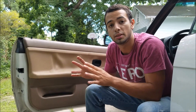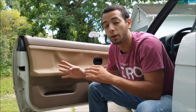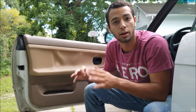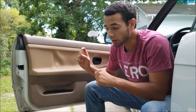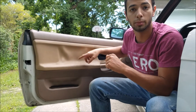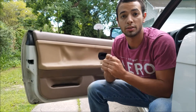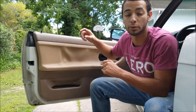The issue with his was kind of really obvious to me. The door panel is still on it, but I'm going to pull it here in a little bit. When I press the button going up and down, the window doesn't move at all, but I can hear the motor and the regulator moving around. My little brother's been moving the window around manually.